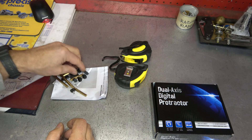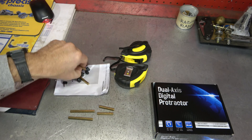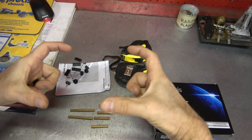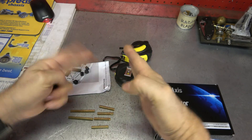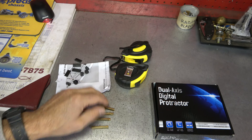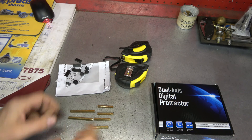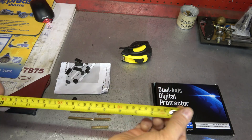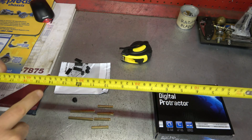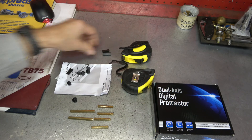What we're going to do is put these in — and I'll go through this once we have it on the car — but we're going to be able to line these up flush with the rim so it's exactly even and not offset accidentally, not toed in or toed out. This allows us to touch the rim in exactly the right place so we know everything is set up right. Once that's set up, we'll use our tape measures going right through the center of that alignment machine, and you're going to be able to see — oh, turn a little bit this way, turn a little bit that way. Really cool stuff.